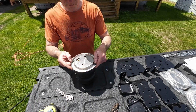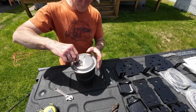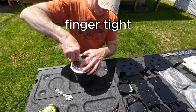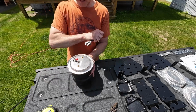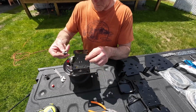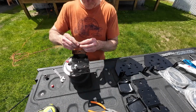Place a roll plate on top of the air spring with the rounded edge facing down. Then install one of the 90-degree swivel fittings. The upper air spring bracket is now attached using the proper hardware. This bracket must also be oriented properly.